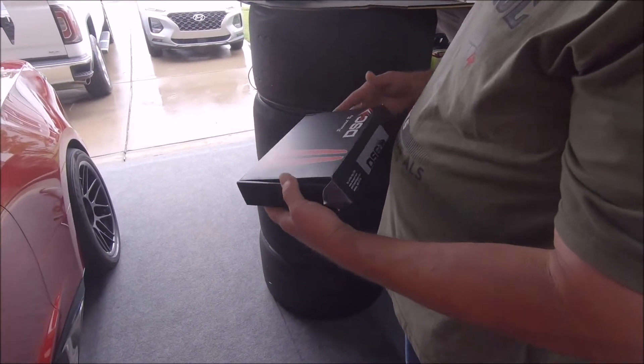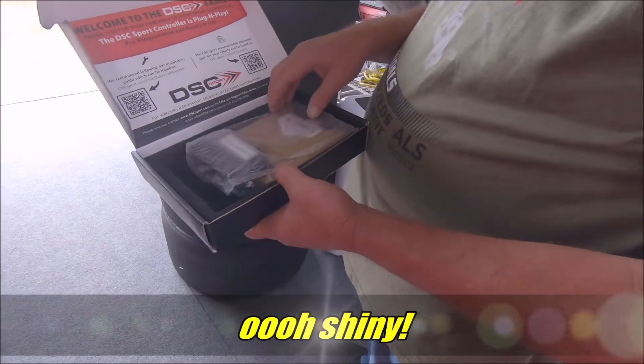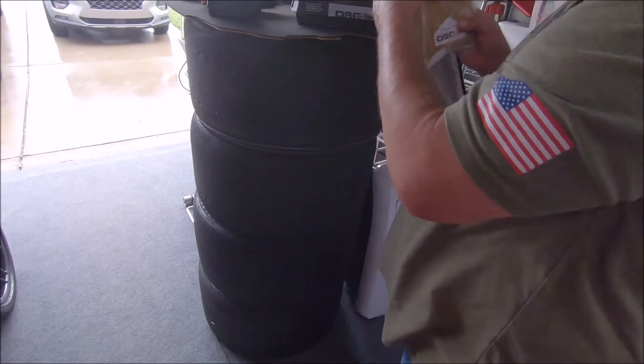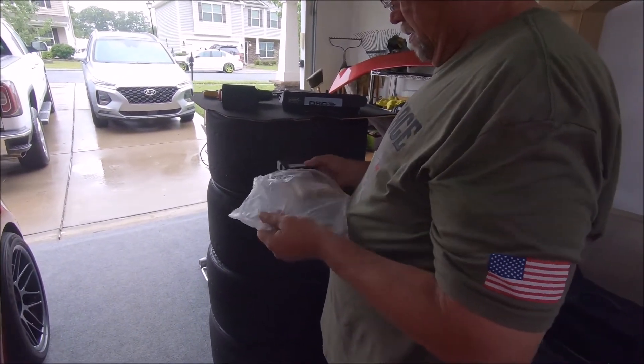We're over here at Ron's garage. We've had a really unstable weather pattern here in Charlotte — thunderstorms and rain — and he's on Goodyear 3Rs, so I came over here to film the rest of the install. What we'll do is remove the interior trunk panels, get access to where the stock factory shock controller is, remove the amplifier above it, put the new module in, and then run a 15-foot USB cable through the passenger side of the car into the passenger compartment so we'll be able to program it from inside the vehicle. On the end of it right here is where the USB cable goes, and we'll want to electrical tape it because it can potentially vibrate out.